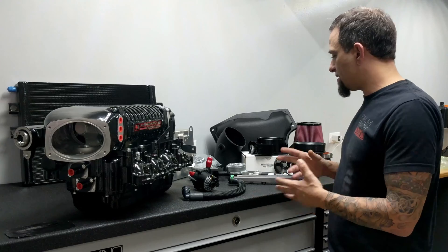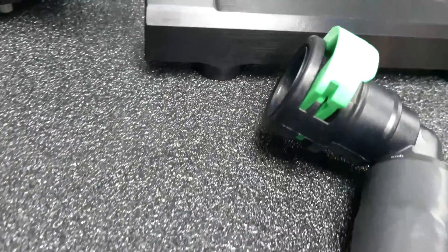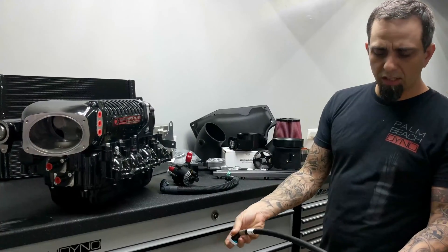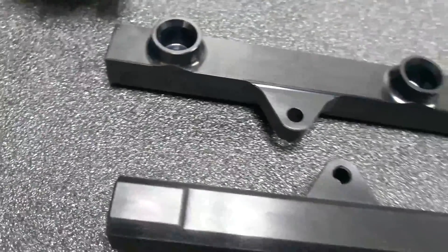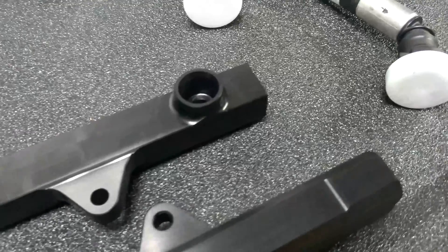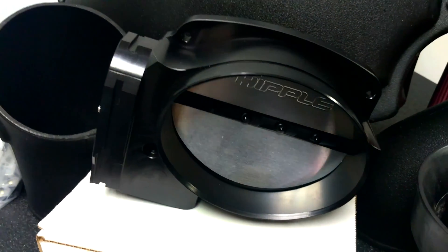There's ways they could probably save money in this kit, but they didn't. Here's a good example — the hoses. This looks like an OEM hose, because it pretty much is, other than it's Whipple's hose. Most of their hoses — I think all of them — everything's plug and play, OEM quality. As you can see, they're all crimped connections, so there's no possible chance of them coming apart. They even come with their own billet fuel rails, which a lot of people go and do as a separate upgrade. They come with the Whipple supercharger. Everything's very nicely machined. I don't really have a single complaint. Their pulleys are nice — there's not a cheap part on the kit.